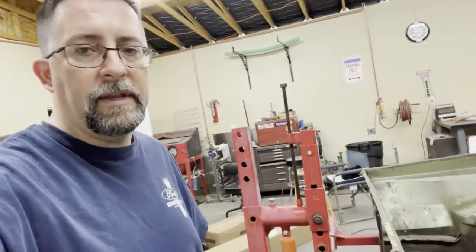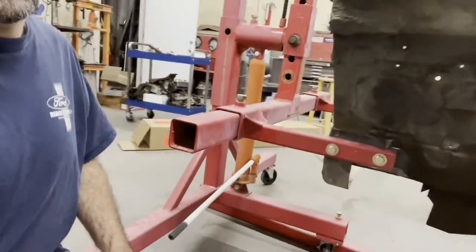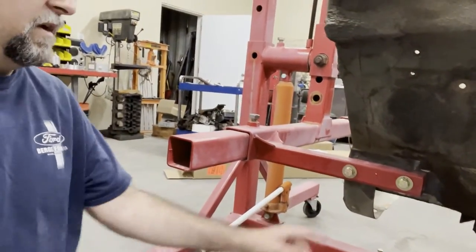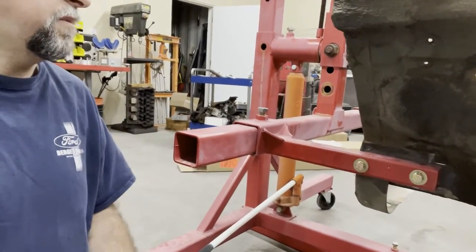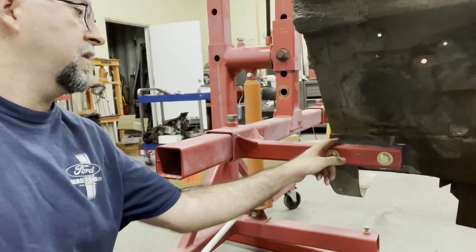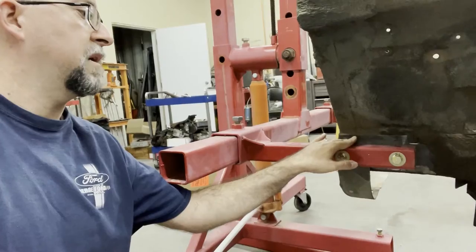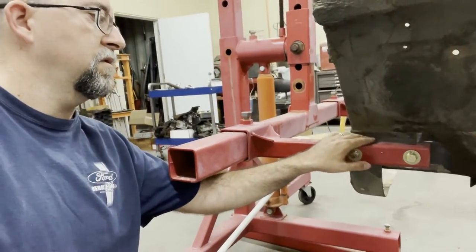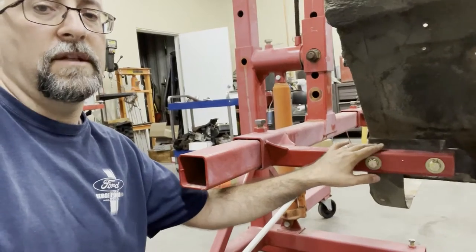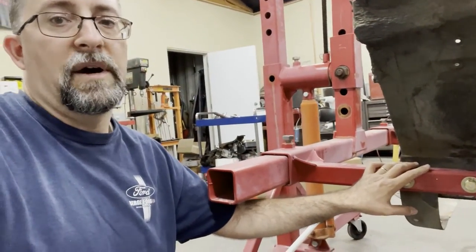Coming up to the front of the car. I didn't have to make any special brackets for the front — I was able to just utilize the existing arms off of the rotisserie. I just had to drill a second hole here for the bumper mounting bracket. You do want to make sure that you clean off any of the undercoating, rust, or anything that's behind it, because when you blast it they're not going to be able to hit that part. But you mainly want it to lay flush against the arm — you don't want any rocks or chunks in there binding it up.